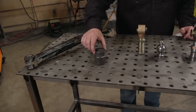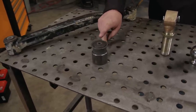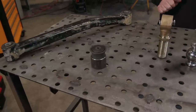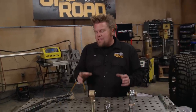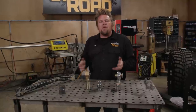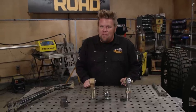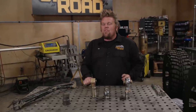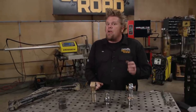On a stock suspension system, they use mostly rubber type joints. This is a piece of rubber with a steel sleeve vulcanized to the outer edge as well as to the inside for the bolt to go through. This is a stock replacement joint for a Jeep TJ upper suspension. The benefit to the rubber is it removes any possible vibrations in the drivetrain before they can be transmitted up into the passenger compartment — great for a vehicle you're going to drive on the road every single day. The downfall is they don't articulate very well, and when you take your vehicle off-road and force them to flex, they tend to wear out prematurely and need to be replaced.